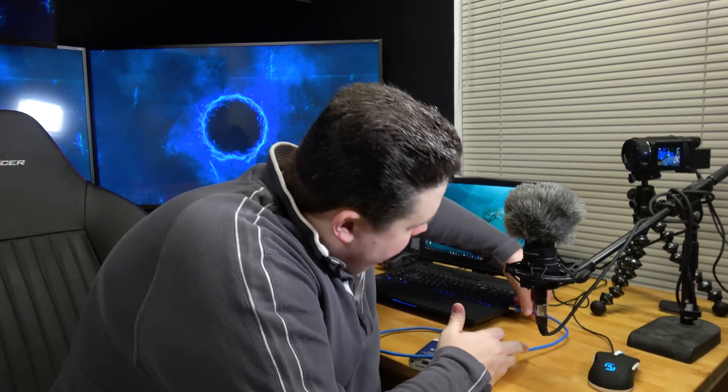I'm going to show you how easy this device works. I already have my camera on over here — I'll flip it around so it's pointing to me, then go ahead and plug this into the computer. One thing to make certain of: you want to put this device on a USB 3 controller pretty much by itself. You can put some other devices like mice on there, but realize this is putting out a 4K stream and it's going to saturate that bus. You won't want two or three of these on a single USB 3 bus — spread them out over multiple controllers. If you want to use a ton of them, you might even want a PCIe add-in board for more bandwidth. Once plugged in, you can see there is a blue light on the device indicating everything's okay. If there's a problem or a bandwidth issue, it will flash different colors — as long as you're blue, you're good.